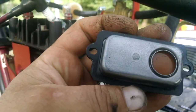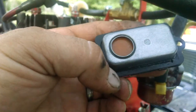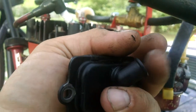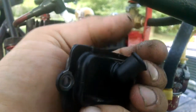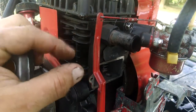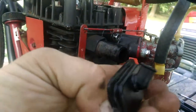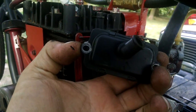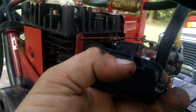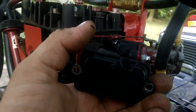In order for the air to go through this, it's got to exit the engine — which is what this piece does. That's your PCV valve. It's a one-way check valve with an oil-air separator. There is a top and a bottom. You see the two little holes here — that's the bottom. This is your check valve, and this is the hose that vents to your carburetor or just vents out. That's where the oil is spitting out. Because as the engine is blowing and sucking the air with oil mixed in, it goes through here. I modified the governor to go faster so it's overworking, and this thing is filling up with oil but still moving the air. When it fills up to where it reaches the hose, it blows it out. That's the problem.